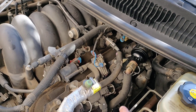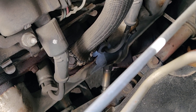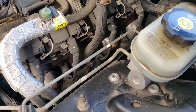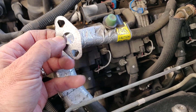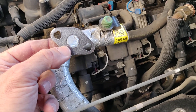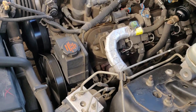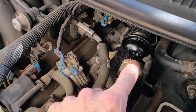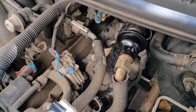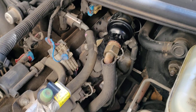I put the new ones on and I did not have to mess with taking this off the manifold, which I dreaded — because those bolts down there are rusty and you never know when you'll tear off a bolt head and create more repair work. When I put the new ones on, I always put anti-seize on fittings like this — a little copper anti-seize around the threads. Hopefully if anyone ever has to do this again, it'll be a little easier next time.